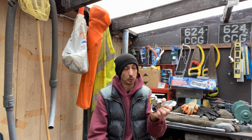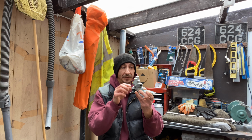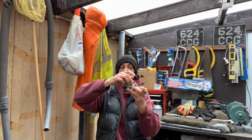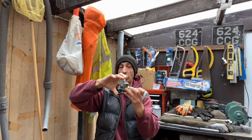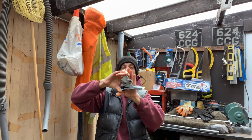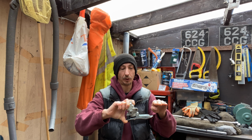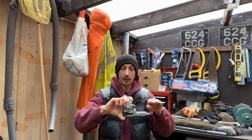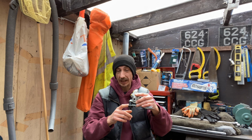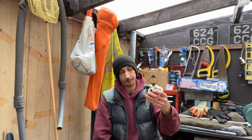Yeah, so when we jack the vehicle up, we should actually see movement in the old one. So as the vehicle goes up, it's going to close this valve. There's weight on there at the moment anyway, so if we presume that there's weight on there and it's pushed down like that, then as we raise the van up, this is going to close the valve. We might not be able to pick it up on camera. We might, I don't know, but we'll get the camera underneath anyway and we'll see what movement there is as we jack the vehicle up.